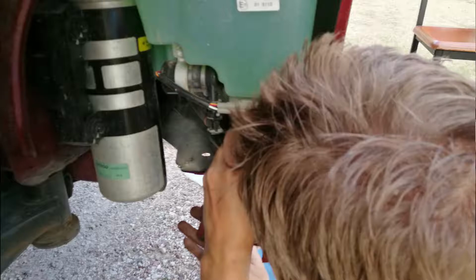So if you're going to replace the fog light altogether, the enclosure and everything, I'd say pull off the plastic shroud with the plastic clips. Just be careful with them. But pull off the whole shroud. It's going to save you a lot of time, because taking the shroud off and putting it back is like a 5-10 minute job maybe. Replacing the fog light with that off, 15, 20, 25 minutes. So once you're done, you're up to like 35, 45 minutes.